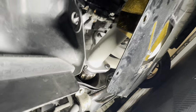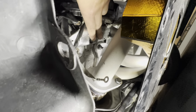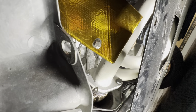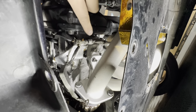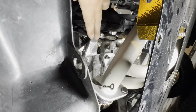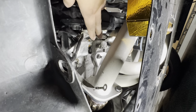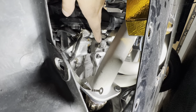Now I'm working under here — very hard to show. But if we move the O2 sensor line out of the way, you can see this hole right here. It's unused in the cam solenoid. We're actually going to thread the bolt right into that hole. It's going to take a little trial and error just to get it threaded since you're doing it kind of blindly. This is an O2 sensor line — I'm going to try to tuck it up underneath the heat shield so it's away from the headers. Once I get that threaded I'll show you the next step.